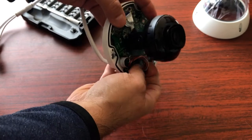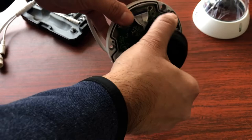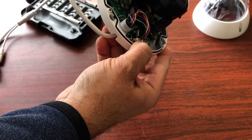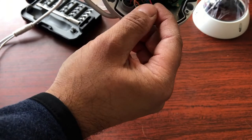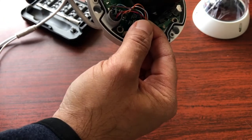Inspect the camera and make sure there's no cable that's been cut. This is how the camera moves around, and a lot of times when people are moving it they're going to collide with the cabling harness. Make sure the harness is not in your way when moving the camera, and inspect all cables to make sure there are no breaks or cuts in them.